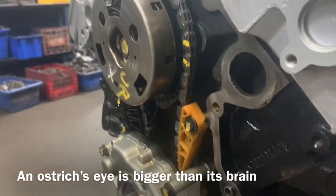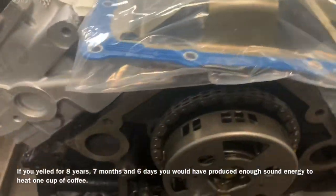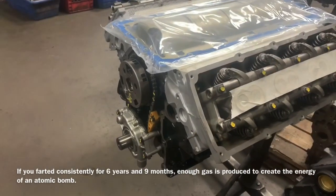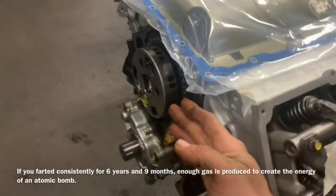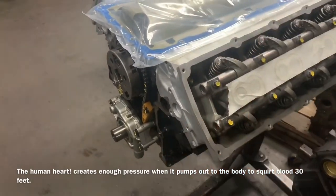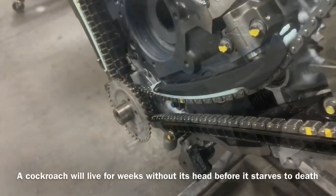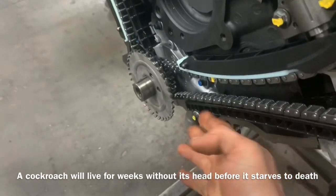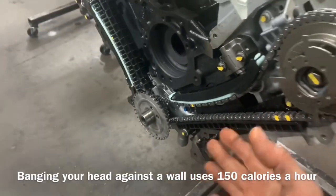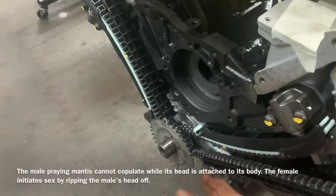All current vehicles have what's called crank sensors and cam sensors that tell the ECM where the engine is at. This would have a sensor that goes right here and points into the side of this right here, telling the computer where the engine is located at. And here's a Ford design. It's actually on the front of the harmonic balancer. So these can be located just about anywhere on the automobile. It just depends on the different types of manufacturer.